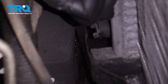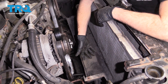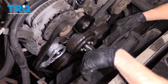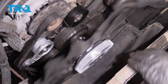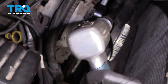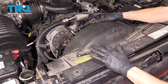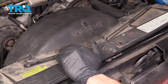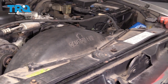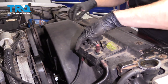Now we just want to double check to make sure that our petcock is 100% closed — this looks great. For ours personally, we had those two bolts that were missing down along the bottom, so I'm not necessarily going to worry about those, but of course you would want to start them in. Now it's going to be time to get this fan clutch on here. Line it up, turn it clockwise — we've got this started. Let's go ahead and bottom it out and then snug it up. Now let's get this upper shroud in there, line this up with its mounting holes, and put in our three bolts that come across the top and the two that go on each side. Give your fan a quick spin to make sure it's not hitting up against anything. At this point, let's continue on to putting our wiring back across here and mount it back in so it's nice and secured.